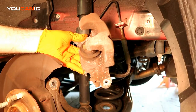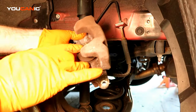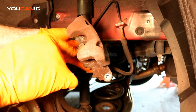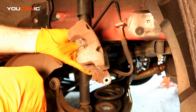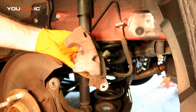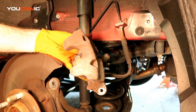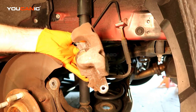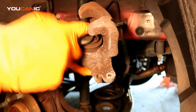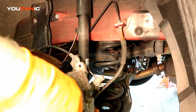The rotor had to be removed using some hammer force to knock off the corrosion and rust. This caliper is a little different in that it has these little slots in there, which means we need to spin this one back — in reverse order — to get the caliper piston to retract. You need a special tool for this; you can't just use a generic tool. You can get a decently cheap version or rent this tool from your local auto parts store. It sits in there with a plate, and it spins the piston backwards.